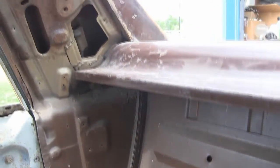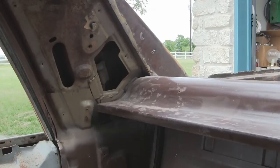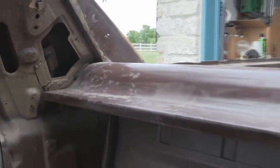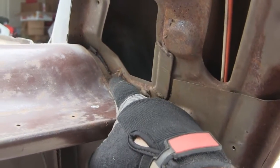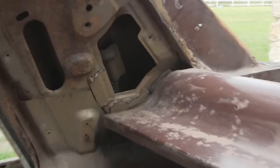What I was going to do is just come in here with my cutoff tool and start whacking stuff out, but since I've never deconstructed an El Camino before, I'm going to do it a piece at a time and sort of pretend that I'm going to reuse the parts and put them back in. So what I'm going to do here on this package shelf, or whatever this ledge is across the top, it looks like it's just fastened with some seam welds on the top here and the same thing over there — so I'm going to cut those first.